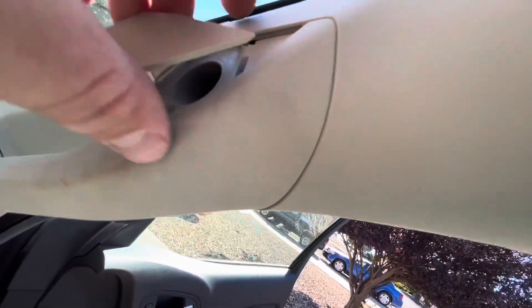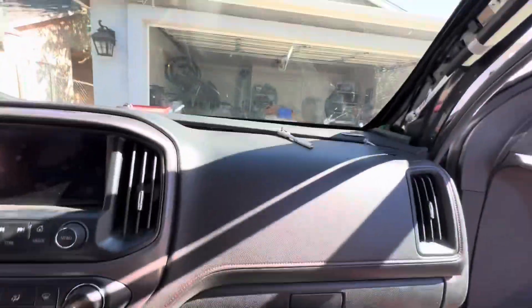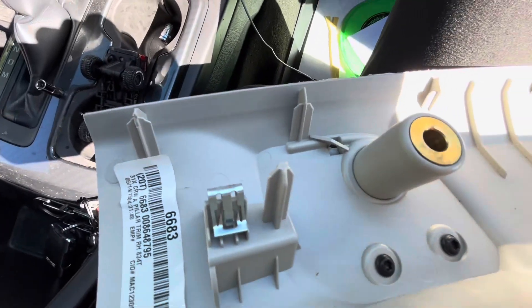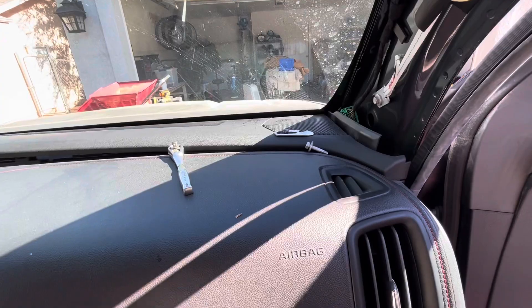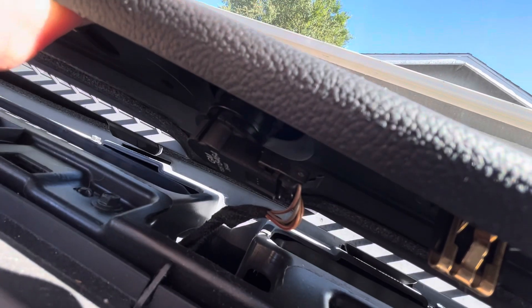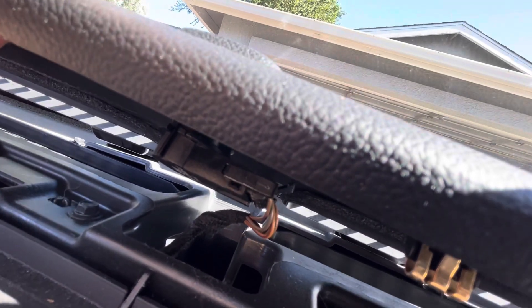This one, I think it's going to be like a 12 — probably like a 14. Let's see. So that was it: the two grab bar bolts held it on, then there was one little clip. You just grab on the grab bar after you got these bolts out and pull. Then we got our handy-dandy little 7 millimeters — one right there, one right there. Take those out and then this dash will pop right up and you can take it off. There's a little connector underneath there — you just squish on both sides of it, pull it out, and it'll come out.